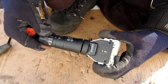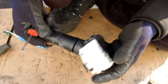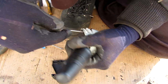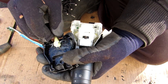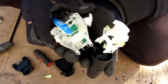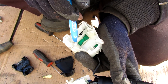Here we have the combination switch — it's called that because it has the headlights, fog lights, turn signals, and high beam back and forth, as well as the cancellation tongue we mentioned. The whole thing is held together by two screws and a bunch of tabs. After removing the backing you can see a circuit board inside. The turn signal mechanism has a little tongue that's slightly spring loaded and moves side to side as you engage the turn signals from left to right. The actual clicking is caused by two little spring-loaded points that ride against this little cam profile on either side to click and engage on one side or the other.